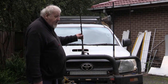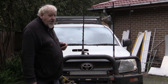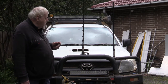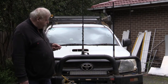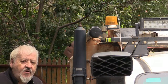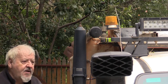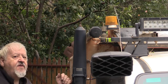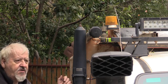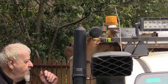This placement isn't preferable at the front because of the HF frequency and wavelength. I have a little trick: if I'm in the mountains I set it up this way, but if I'm not using the HF I pull the aerial off and store it in the tube at the back. Same with the two-meter antenna. This is the automatic tuner for the Barrett, which is set up to work on amateur bands as well as the 737 network and a couple of other four-wheel drive networks. The auto-tuners are pretty good.